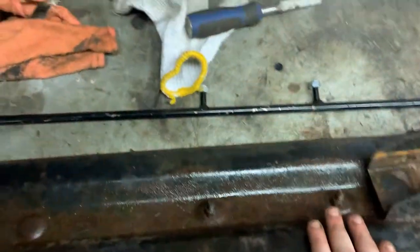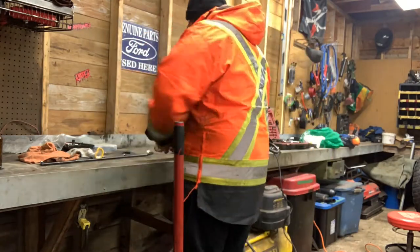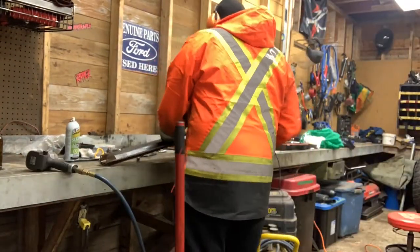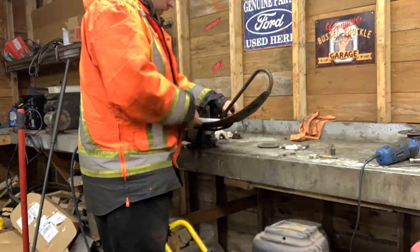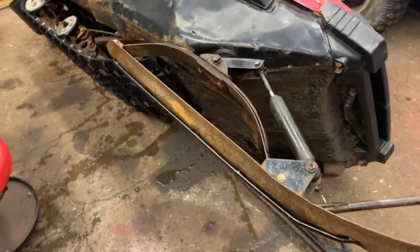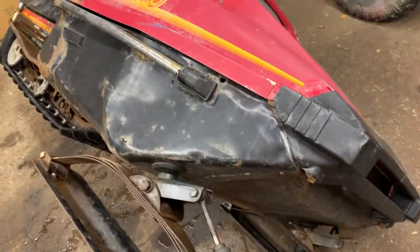First order of business for the new ski is getting a carbide put on her. I got a little bit of oil on all these bolts — I'm going to unbolt them and hope they don't break off, then put on the new carbides. I'll do the same with the other side. Okay, so we got one ski on, we got rid of the broken ski, so now we actually got a complete ski. I got the carbide on — I think you call them carbides even though they're steel. The other side I'm going to put the carbide on and then I guess we'll try swapping out the hood.